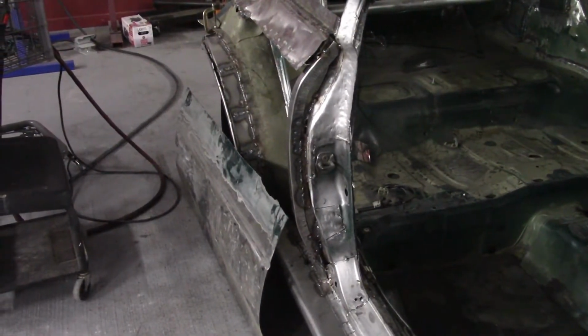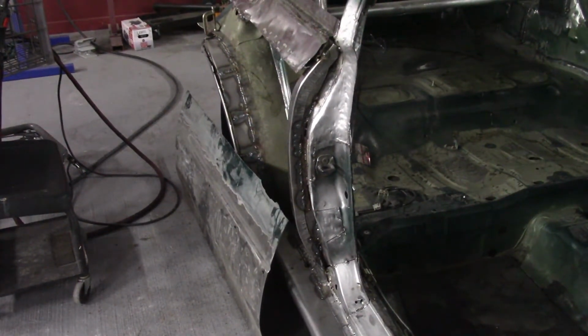Here's a view of the new door jamb. The shape is relatively good, although it's very difficult to work with the shrinker stretcher to make these panels exact, especially because there's a limited width on the shrinker stretcher, and beyond that you start to get wrinkles and the metal will be too long to fit in the jaw. So it's really for trim, I think. But it works pretty good for this purpose.